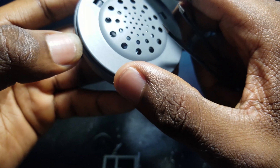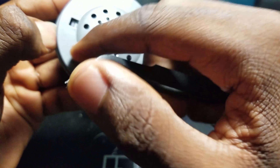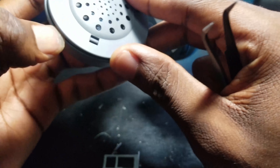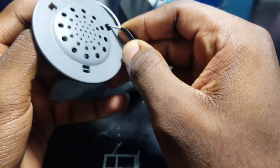What you first wanna do is take your nail, place it in the ridge of your headphone just like this, just to apply pressure. So that way when you push this clip outwards, it actually applies enough pressure in order to push it out — just like this. Now it's unclipped, and we're gonna do the same thing for the other two. Alright, last one. Just like that.